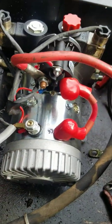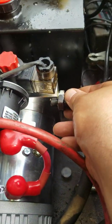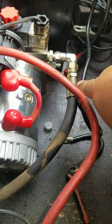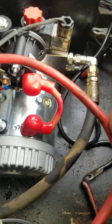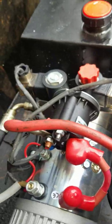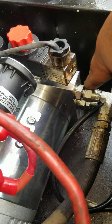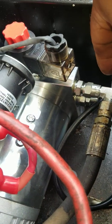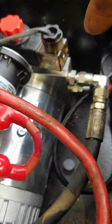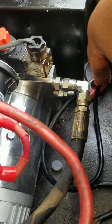When I got the pump, it came with fittings coming from the block, but this fitting was not going to work with my hoses. So I had to go find these elbow fittings — these small ones that are installed right here. It's like the one that came with the pump, so all you have to do is loosen them up — they're really tight — take them off and put on the ones that fit your hose.